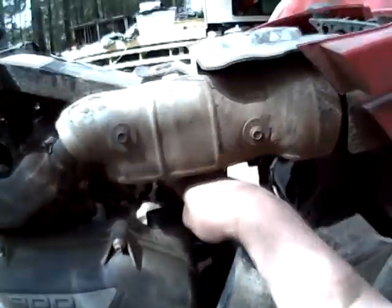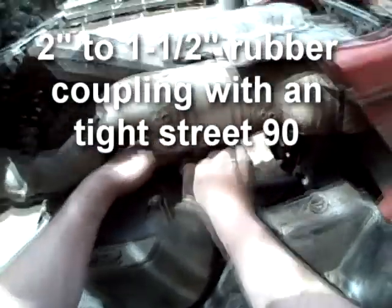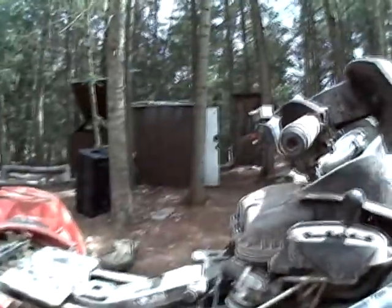The question remaining is about the angle — maybe that's why others have been going in through the back side. The plan was to come up into the pod and back down, because I don't want the hot exhaust from the CVT going into the intake for the engine or for the CVT itself. Anyhow, that's going to take a little bit of figuring out.